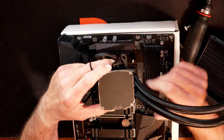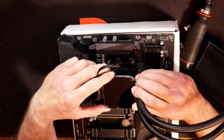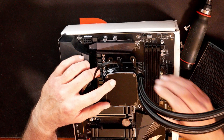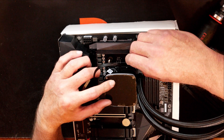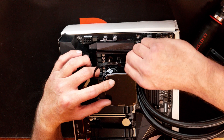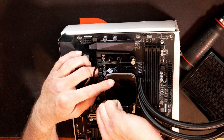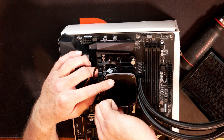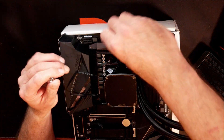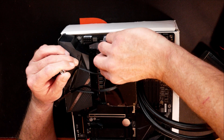You want to make sure your hoses are towards the RAM slots. If we put the brackets and the standoffs in the right position, they should just slide right down on top of each other — and it looks like we did our job fairly well. Now putting these thumb screws down on these tension screws, you do want to do this in a cross pattern. You don't want to put too much pressure on one side of your CPU over the other, as that could cause overheating issues or your system just not to boot up.